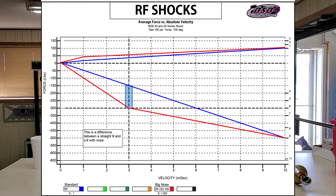A right front 1-40 is a beginner shock for rebound on the right front. Right front 1-50 is what a lot of people run — that's a pretty primary shock for that car. A 60 or 75 starts tying it down harder and harder. That right front 1-50 is about a seven or eight rebound shock. If you ordered a 70-10 it would not be the same — the low speed in a right front 1-50 is much greater than a 70-10.